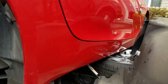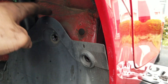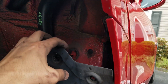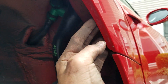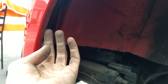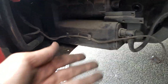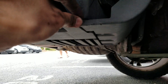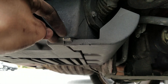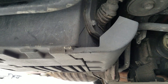Once you get that done, the hardest part is to peel off the wheel well. The way I did it is to start from the front here — the wheel well sits behind here — peel this all the way down. It's flexible, don't be shy with it. Work the wheel well out, pry it all the way around, then push it forward. I bent the front half of the wheel well forward and then the rest popped out and slid out. Just be careful with the bottom half — there's a little plastic tab from the trunk cover panel right here. Make sure you pull out, don't push down and break it off.